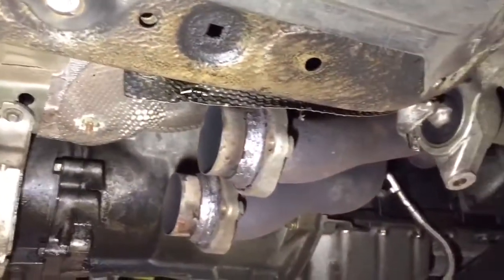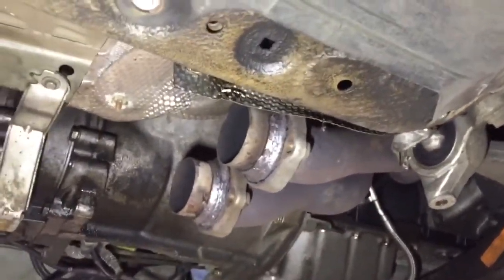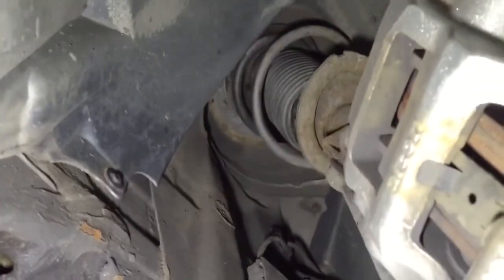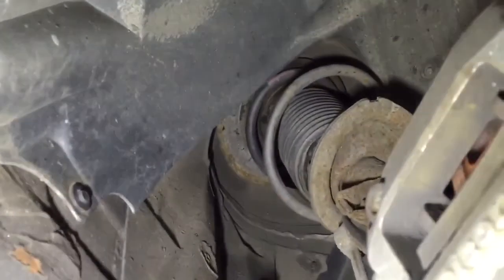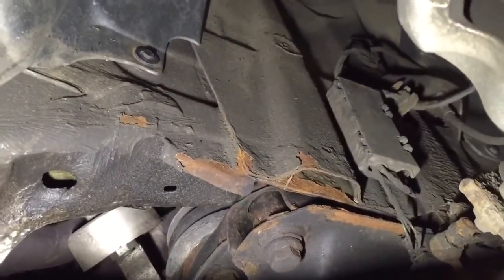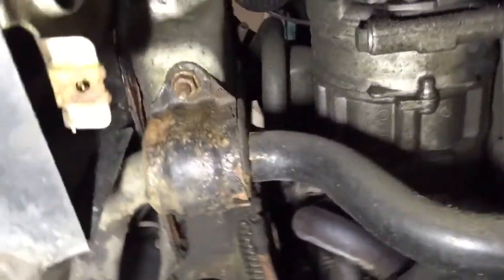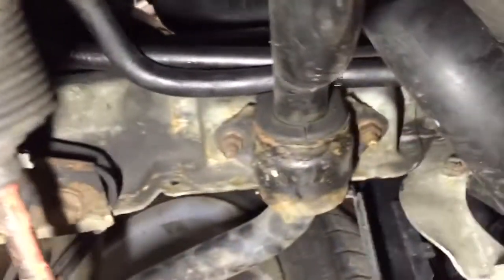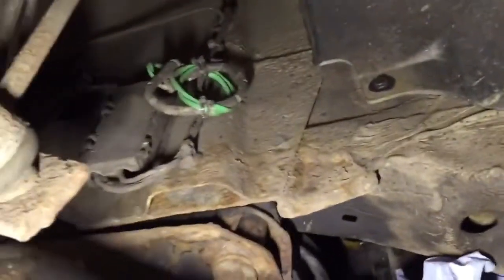Now we're sort of halfway under the car, going up towards the engine bay. There's the exhaust manifolds. On the other side of the car, the passenger side, it's very good. A little bit of corrosion. Now we're looking at the front turret. Corrosion up at the turret. Again, this is all surface really, there's nothing structural. And paint coming off, or sealer coming off on the front right. A little bit around the anti-roll bar mounts. But all in all, it's what we'd expect on most M3s, to be honest. Nothing really to worry about, I don't think, up here.